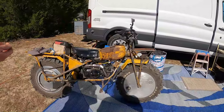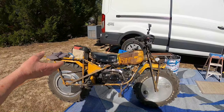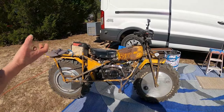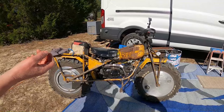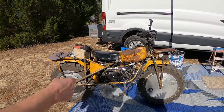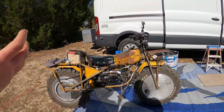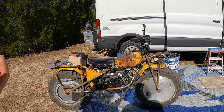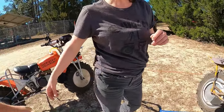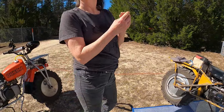So I'll go back. Back in the day, there was no internet, there were no forums. And when these bikes were originally made, they had less than optimal clutches. It was like a fluid drive, which would blow the O-ring when it got hot. So you're referring to a stock one, the stock 1962 through 65? They had a lot of clutch issues, with that transmission? Yes, the same transmission but a different clutch. The problem wasn't the transmission. These things will last forever. It was the clutches.